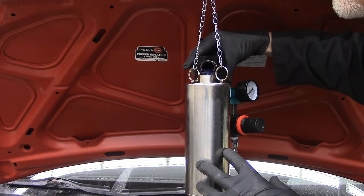Adapter comes out. I'm gonna wipe that off a little bit later on, then I'll put the fuel line back in. And then nobody knows that we were in there. Except it should run better, we hope. Tight, doesn't have to be super tight on this car because it seals by the O-ring. And these bolts don't tighten that O-ring. They just hold it in so it doesn't fall out. All right. And we're gonna put the fuel pump relay back in and close this up. And take this down.